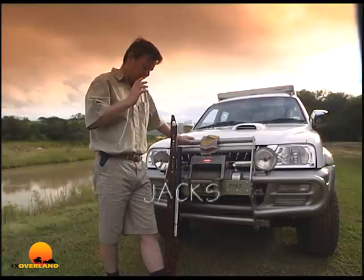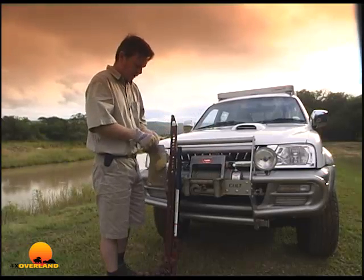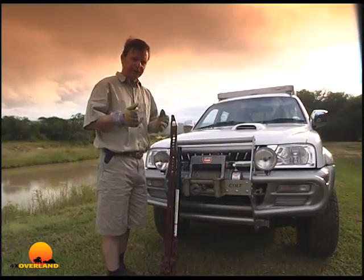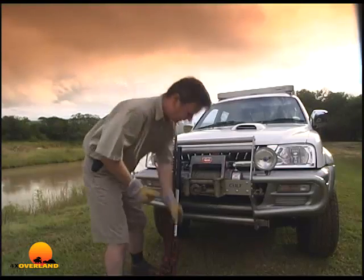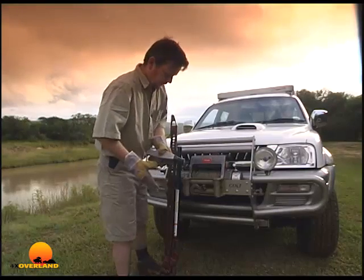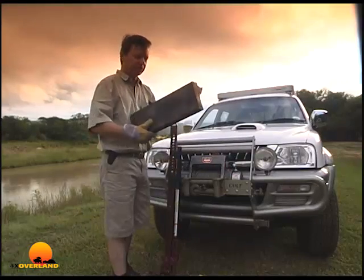There are two types of jacks we're going to speak about: the high lift jack, and the air jack or balloon jack. The high lift jack kit consists of a pair of gloves, the jack itself, and fittings on the vehicle and jack to allow you to jack it. Vehicles from the showroom floor are generally not equipped for lifting with a high lift jack — they need some kind of bull bar or bar on the back to allow the jack to work without damaging the vehicle. The other part of the kit is a jacking plate. Most of the time when you need a jack, you're jacking because you've sunk into soft ground, and the trouble is the jack then sinks into that soft ground too. A practical alternative is a piece of wood like this.